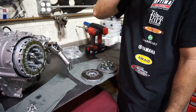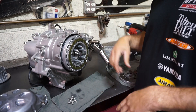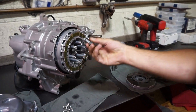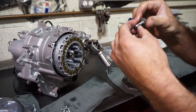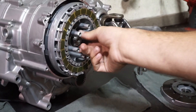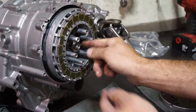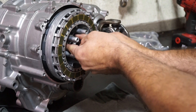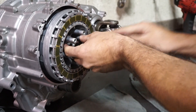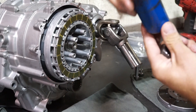One of the things we learned is it's kind of tough to get in there to switch out the clutch, and this clutch is pretty in-depth. Once you get to this point, you'll pull out this push rod — it just pulls out, it's got an O-ring on it, so just make sure the O-ring is still in good shape. Set it aside. Then if you have a 30mm socket with the impact, you can loosen this nut. We've already loosened it. It's a 30mm socket, so it's pretty big.